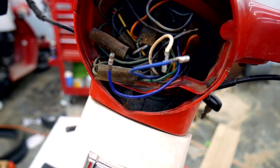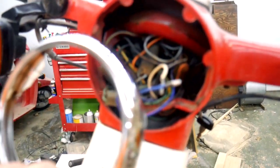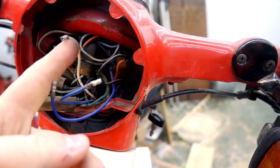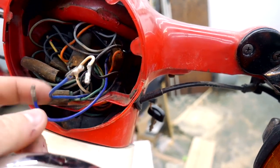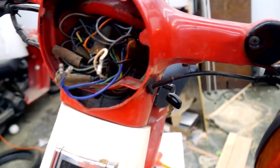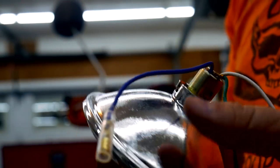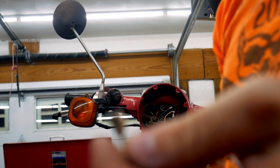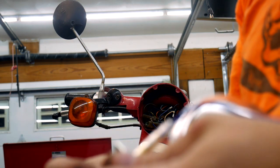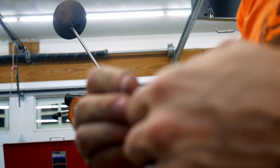So we'll see how well this fits in that space now. I've got to put it all in together. We've got two blue leads and a white lead. The white lead is the common, then we have a low beam and a high beam — I don't know which is which right now, I'm going to find out when I hook it up. The aftermarket headlight only comes with one lead. It's all available on that website — you can also get a 2-to-1 splitter and a little cover for it.